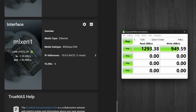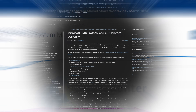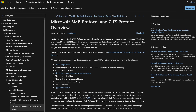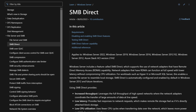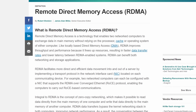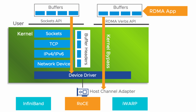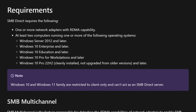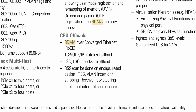I was initially gonna end the video here, but I couldn't get over how bad my performance was using these cards with SMB. Windows is the most popular desktop OS in the world and its standard for network file sharing is SMB, so surely there's a way to get more performance. Turns out there is this thing called SMB Direct, which utilizes a technology called RDMA — Remote Direct Memory Access. What this does is allow communication at the hardware level between two devices, which bypasses the operating system and the TCP layer to give you much faster speeds.